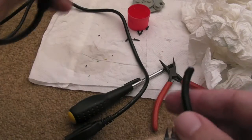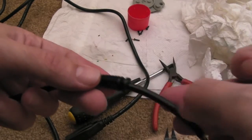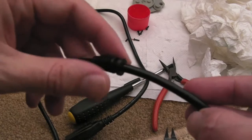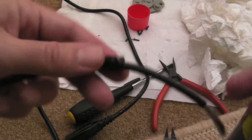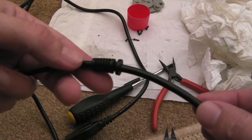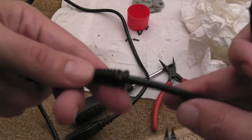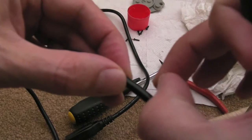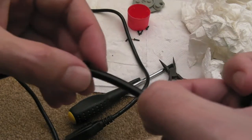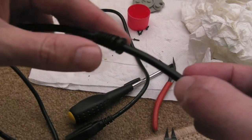There are a few different ways you can approach this. What I did with the grommet is just use a bit of WD-40 — spray the wire and the connector, then with a lot of force keep pushing and pulling on it and you'll eventually be able to slide it along. That's exactly what I did to salvage this so I can reuse it. When you finish your wire fix, you can slide it back into position. Clean the cable up first, make sure there's no oil on it, then apply just a tiny bit of superglue around the perimeter of the edge, slide it right up, and leave it for about 20 minutes — it'll adhere and hold it perfectly in place. That's typically how these are done at manufacture too — they use a bit of glue to hold it in place.